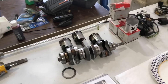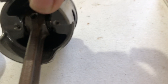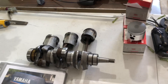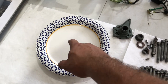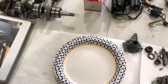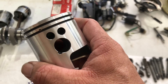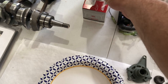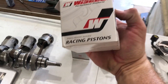Here's the old rotating assembly. What we have to do is take the old pistons off. We've got to push the old wrist pins out, and there's needle bearings inside up in here. We've got to make a special tool to reset those wrist pin bearings — they're not in a roller cage, they're actual needle bearings. There's 28 of them and when you pull the wrist pin out, they all fall out. Here's the new pistons — these are Wisecos. In my opinion, they're a way better quality piston than factory. It is a two-ring piston, coated on top. The shop was telling me that all three pistons were within one gram of each other, which just tells me Wiseco pays really close attention to their product.